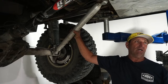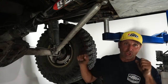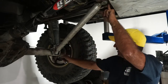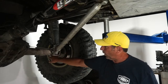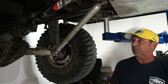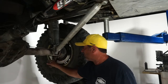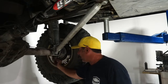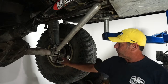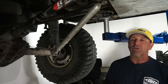By running a Johnny joint on each end of the links, you're taking the shock load out. Each time you slam the wheel on rocks, you're preserving both side mounts — the joint, the welds — rather than cycling them to failure. We saw that this last weekend. If you're using stock mounts welded to a much thicker tube, you'll get a good weld but eventually the thinner material lets go. That's why we're very careful to run quarter-inch-thick tube matched to the 5/16-inch tube on the rear.